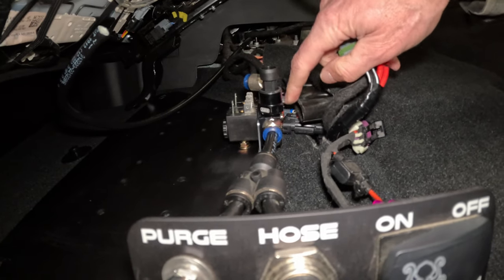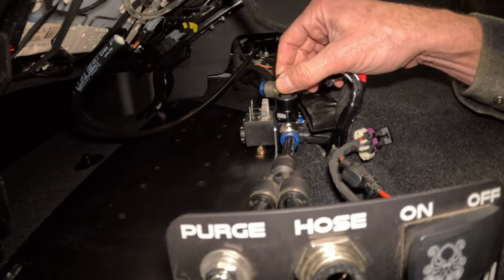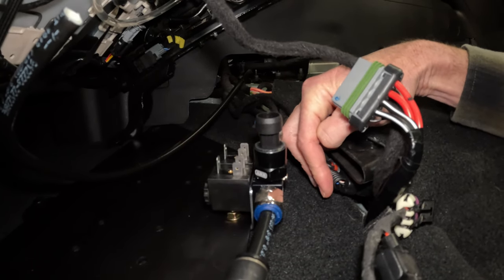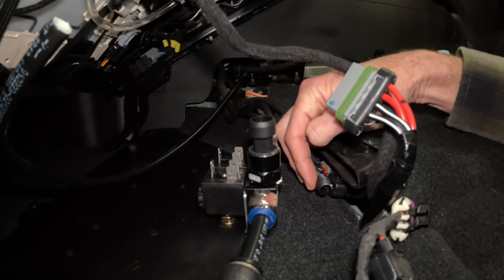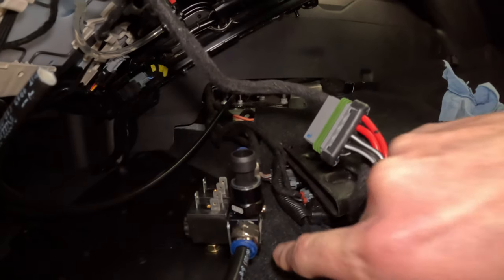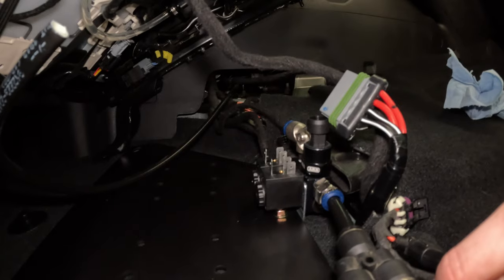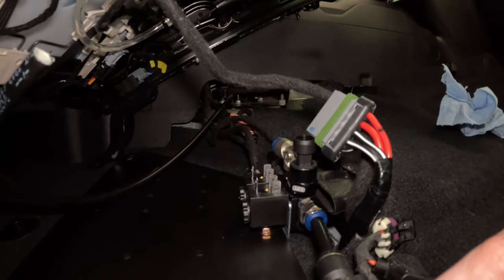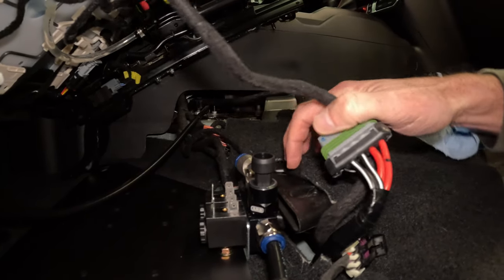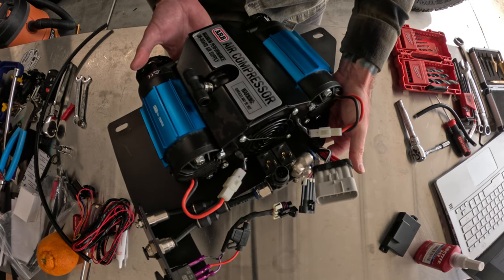You'll notice that under here there is a lot of wiring coming from underneath the HVAC duct — the stock wiring for the Jeep sits under that. Where this is mounted it was wanting to butt up right against those wires, so I went under the carpet and slotted the holes in the bracket that holds these wires, sliding everything forward about three-quarters of an inch. I put some wire loom on there to protect the wires since they'll be sitting just below this when we slide it into location. It is blocking off part of the heating duct, so I'll trim that heating duct back just a little bit — definitely don't want to trim it back too far because we don't want the carpet in front of it.